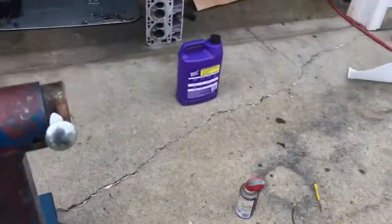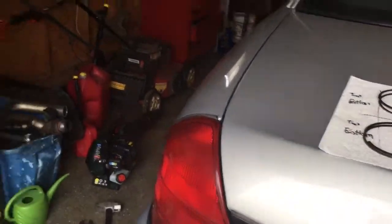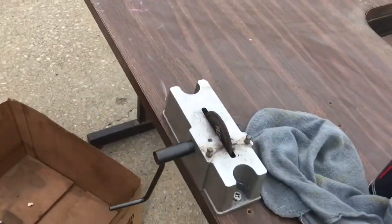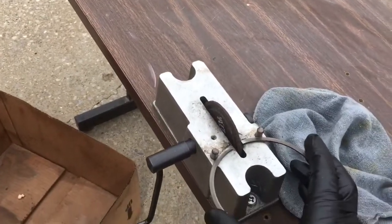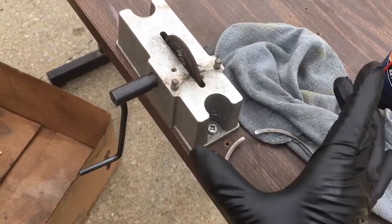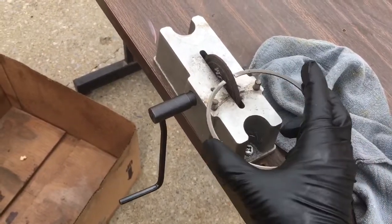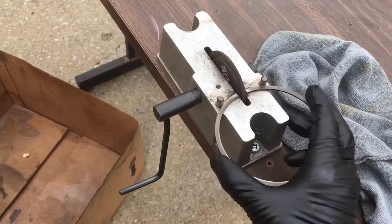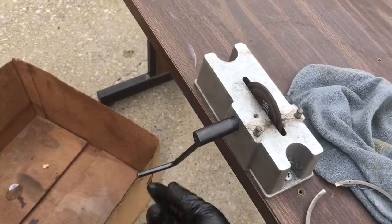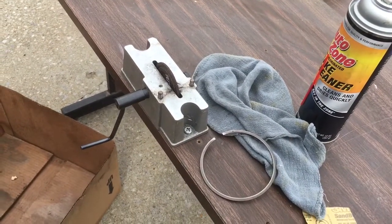And what I've always done with good results is grab a junk ring first, because if you've never done this before, you'll probably screw it up and break a ring like I did. You squeeze it a little bit with one hand, push it right up on those dowels, squeeze it, and then obviously you rotate that with the other hand, and just do a little bit at a time to get the feel of it. It's just what I've done.